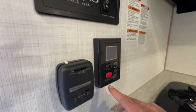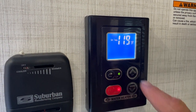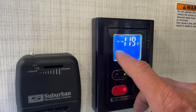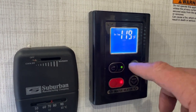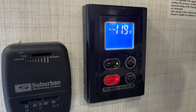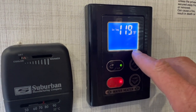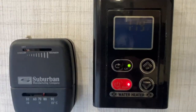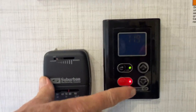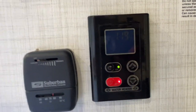We're going to look at the Insta-Heat hot water heater controls. Any time you're going to run water through the faucets, it's going to have a little shower head icon on this side indicating the water is on. Right in the center, it's going to have a little fan icon showing that it's pulling fumes from the outside. And right to the right-hand side, it will also have a little flame that indicates it is lit on gas. You can change it from Celsius to Fahrenheit with the little button below it, and you can dial your temperature up and down.